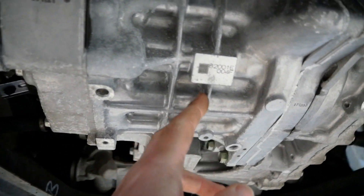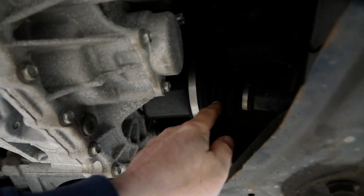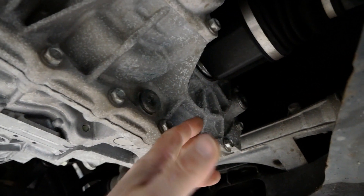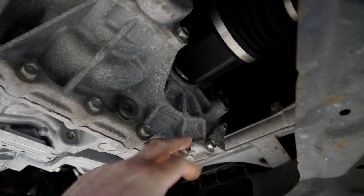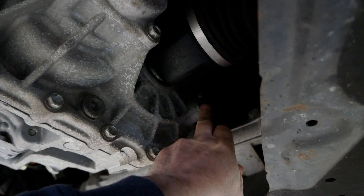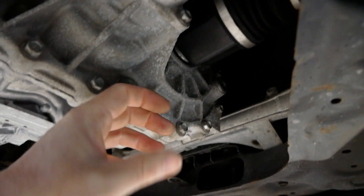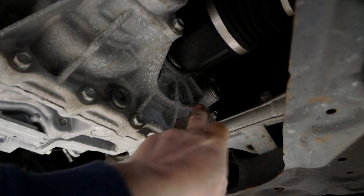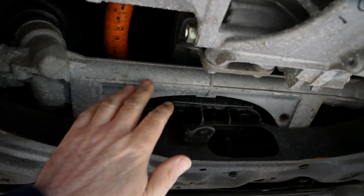Looking underneath, we can now see our electric motor here, driving the front wheels. You can see a drive shaft there and another drive shaft there. At the back here is a small transmission — you don't get a gearbox as such on electric vehicles, but you do get a little transmission which just reduces the speed of the electric motor down. There's an oil fill plug up there, but generally you don't change the oil on the transmission because there are no moving gears — it's just a fixed ratio drive, so the oil will generally last the life of the vehicle.